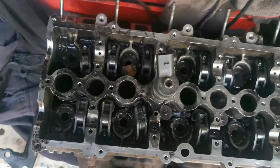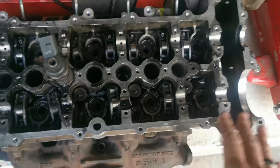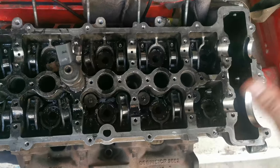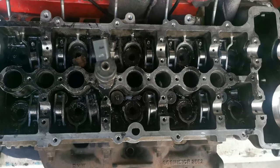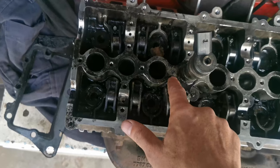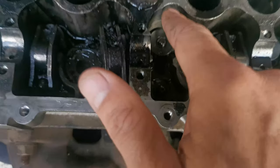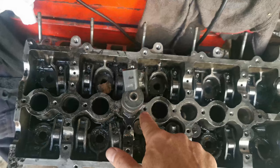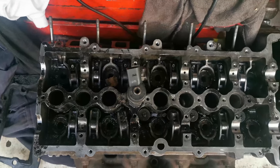I'm not going to remove the valves. If the engineering guys want to remove and reseat them, that's fine, but it doesn't seem necessary. We'll check ourselves if it's warped — if it's not warped, I don't even think I'm going to take it for skimming. We've got one bolt that broke off here that needs to be removed, and the threads are stripped out here — it basically needs to be re-threaded. So if I take it to the engineers, they can do that for me.